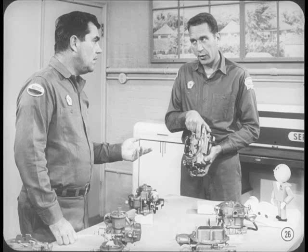What happens if the spring setting's off? An incorrect air valve setting can cause a momentary rich condition at low speed with a wide-open throttle if spring tension is too high, or a lean condition if tension's too low. But spring adjustment is seldom needed.